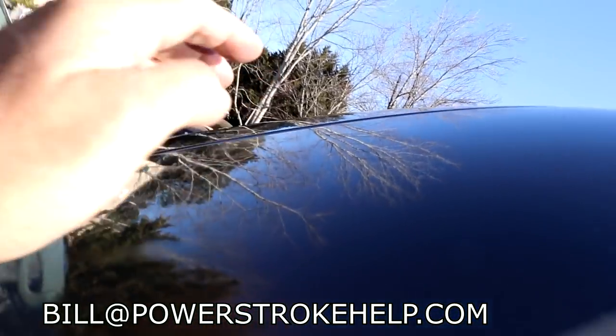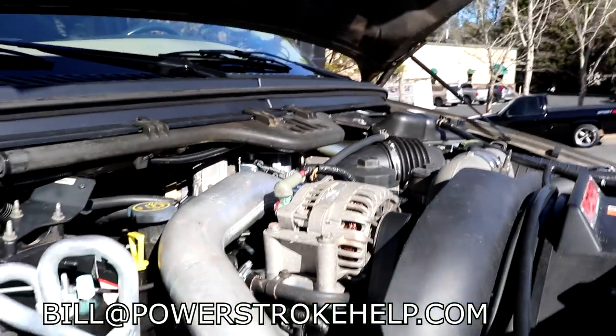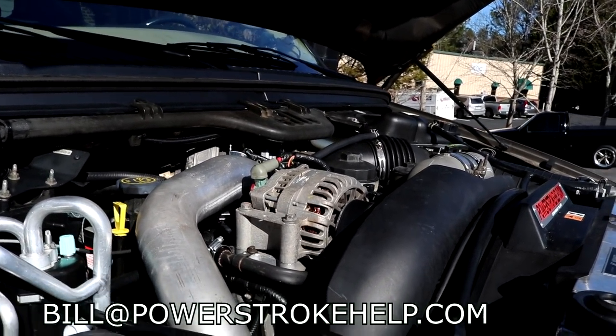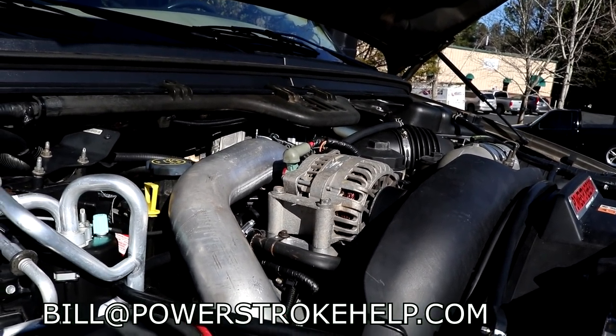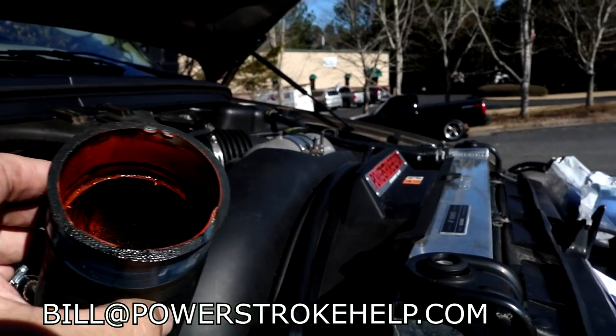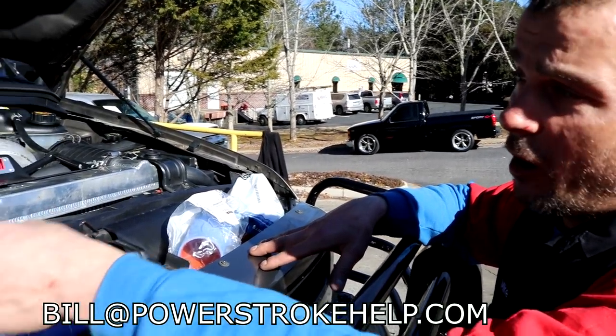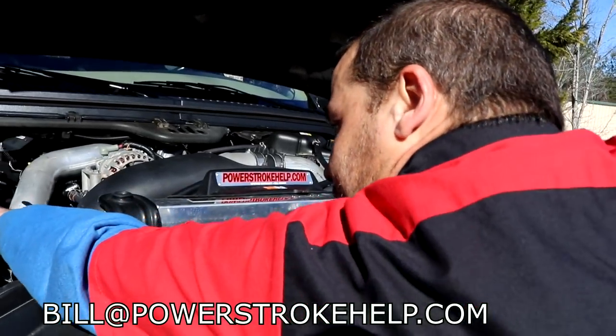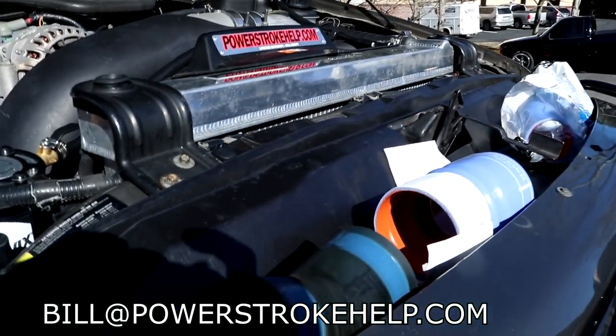Now, this particular one doesn't have it because these are nice, reasonable human beings that drive this truck and don't have industrial diesel injection tuning on their truck, all right? So you start running big injectors, big turbo, that will exacerbate the problem and make it even worse. So most of the failures I see are on the hot side because of the heat. And as he just said, this boot breaks down.